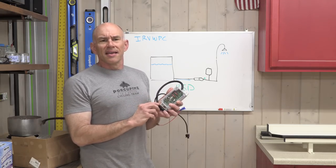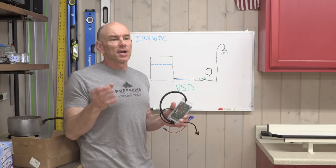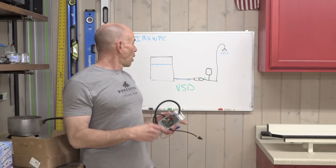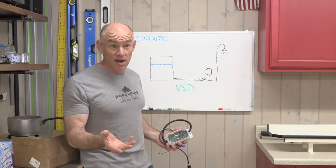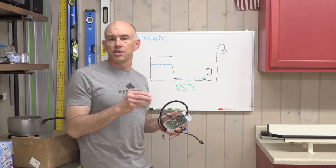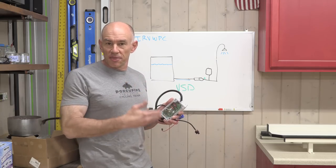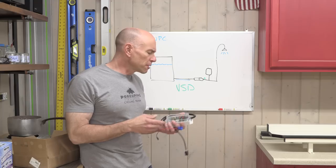Another feature: we don't like to keep the pump on all the time, because if you leave the pump on and develop a leak, you could pump all the water in your tank onto your floor or overflow your gray tank. I prefer to keep the water pump off unless we're actively using it. Since the IRVWPC knows if nobody's using the pump, it has the ability to shut the pump off — the default is one hour, and we're going with that.